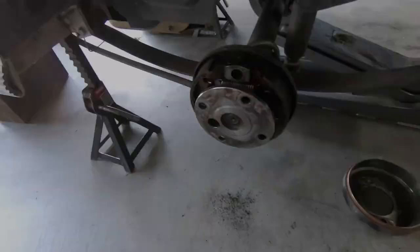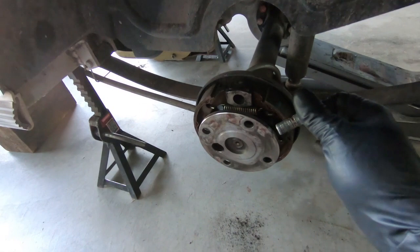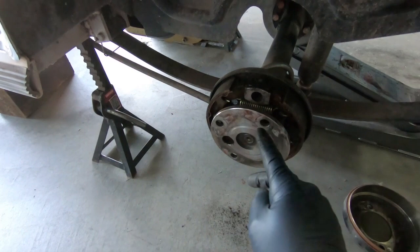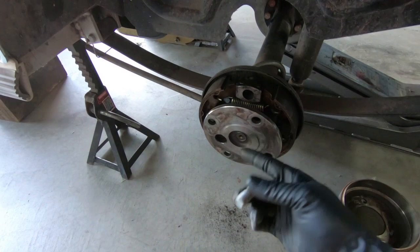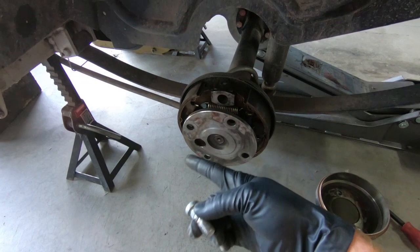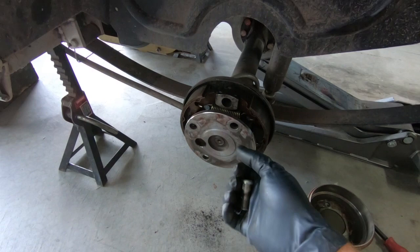It is the next day. I didn't take any of the rear end apart because I had a ton of issues getting this wheel off. Like I said, the wheel came loose and it had been ridden on with the wheel loose — look at my wheel studs. I only bought two and I needed four. I went to the local parts store and found some I can use for now. I'll tap the old ones out with a hammer, pull the new ones through with a stack of washers and an old lug nut with my impact, put a little grease on them, and pull them flush.